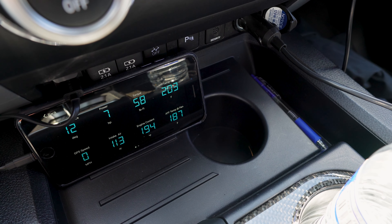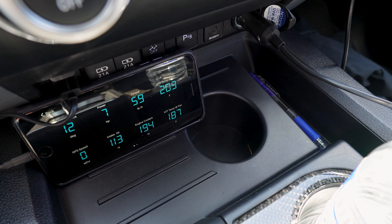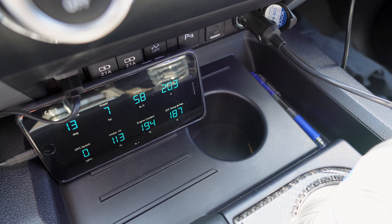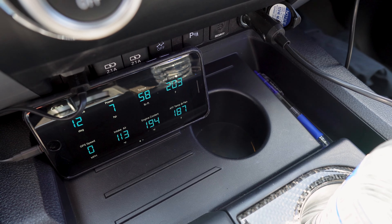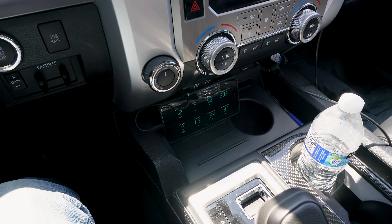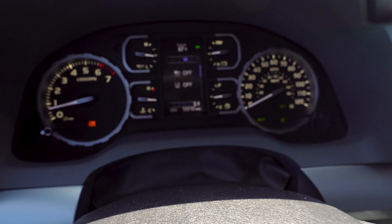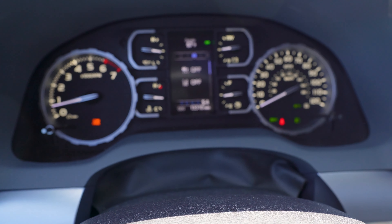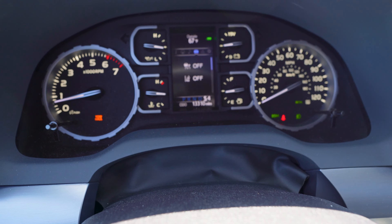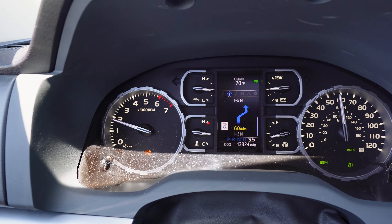This is just a Bluetooth adapter plugged into the OBD port with various gauges — key being top right is transmission temp at the torque converter, bottom right is ATF temp at the pan, and then one over on the left is the engine coolant, and those typically are right around the same. When I'm towing, engine coolant stays right around 195–200, ATF stays around 195–200. As long as the torque converter's locked, that stays within two or three degrees of overall ATF at the pan. The minute the torque converter unlocks, you'll see that shoot up, but it cools right back down with that cooler.